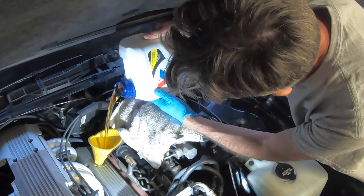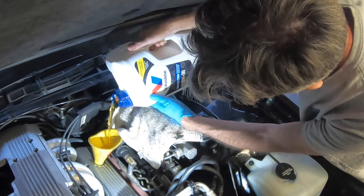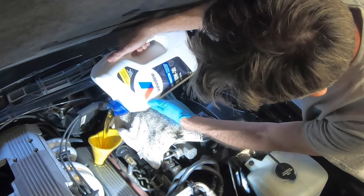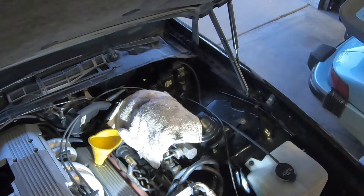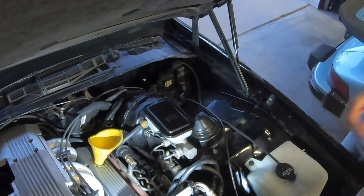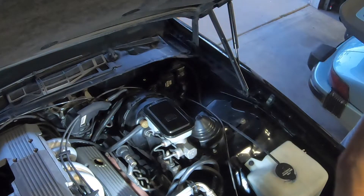That often and it just doesn't become a regular thing. Hey, what's going on? We're pouring brand new liquid gold in the motor — five quarts of 10W-30 Valvoline. American Valvoline, red, white, and blue. That's five quarts. Is there still gas in there? No, there's just a little trace of old oil. That's the old oil in the pan over there. All right, we got the oil in. Now we can take this funnel off, do a little bit of clean up, put our cap on. There we go.